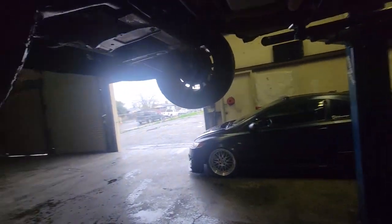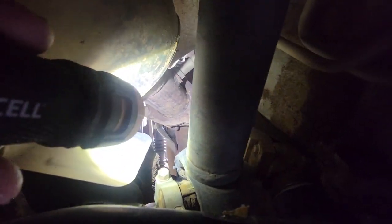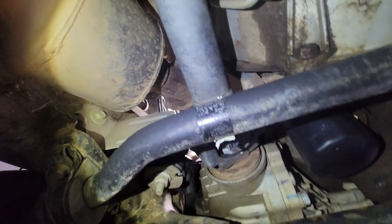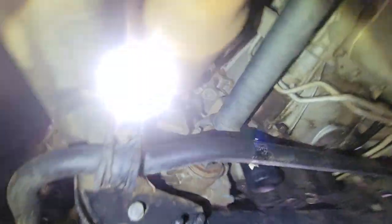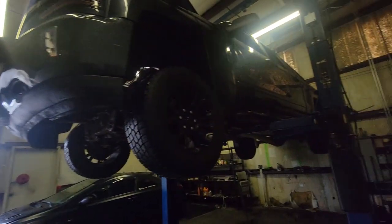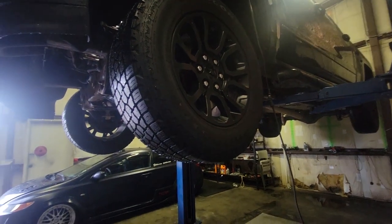What I'm going to attempt is to try to do it from the top. I'm going to remove the exhaust manifold, disconnecting the catalytic converter from it down here. There are three nuts holding the bolts to the manifold log — we'll remove those, loosen it from the bottom, then drop the vehicle down and work our way in. I really do not want to drop the whole differential. I'm going to hit it with some WD-40 and let it sit for a bit.